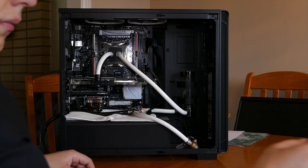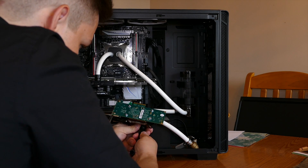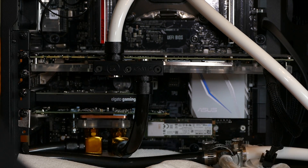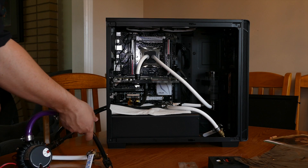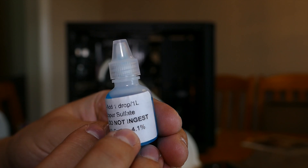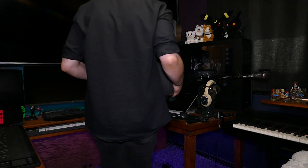Somehow in the chaos of my extended family being over and other poor conditions, I lost the clip of me actually attaching these to the card, so sorry about that. I installed the card back into the PC to make sure the fittings would fit, and they did. These fittings, along with most other 90-degree fittings, have rotary function so you can turn the fitting without loosening or tightening them. With the tubing done, I went ahead and connected the pump I use to bleed individual systems to the quick disconnect fittings in the back of the computer. I filled the loop, tilted the computer around, added some biocide to fight algae growth, and bled the loop while watching for leaks. I didn't test for leaks or bleed the loop for as long as I should, but I was fairly confident as 80% of this loop had already been running for months. I disconnected the pump, put the case back together, and moved the system back into my room, connecting all the cables and the tubing.